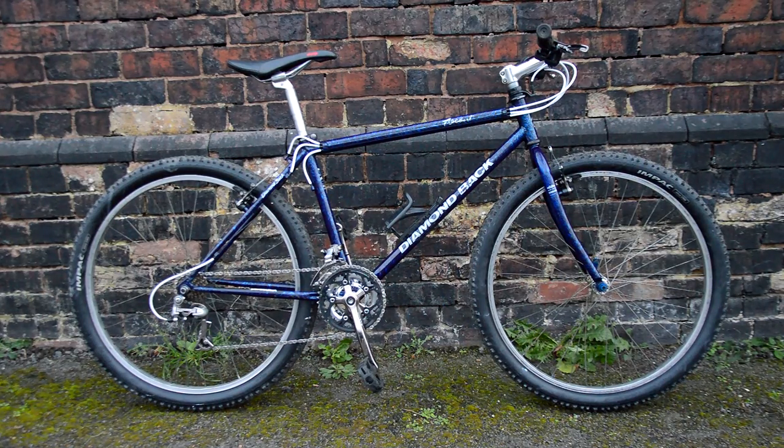Voila, there we go, one complete bike. So I have put the new chain on. It is suitable for 18-speed 3x6, and it runs fine in 6-speed at the moment. I adjusted the derailleur with the gear shifter in position 6 rather than 7, and it works fine, so I can ride around on it as 18 speed until I get a new thingy. What do you call it?